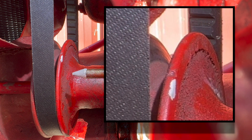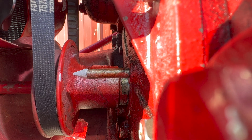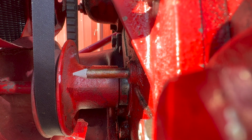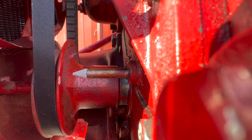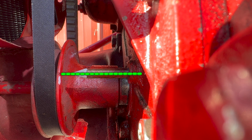Here comes the mark. If you look closely, that white paint on the pulley is actually not the mark — either I did that or somebody else marked it just ahead of where the actual notch in the pulley is. So we'll ignore that white mark for now, and we're at top dead center on the compression stroke on number one. You can see the notch and the pointer are pretty much lined up.